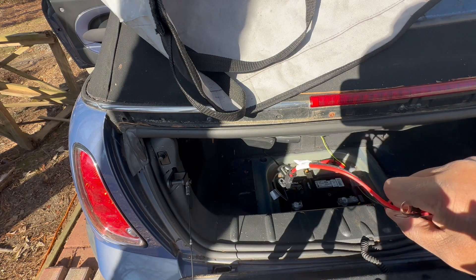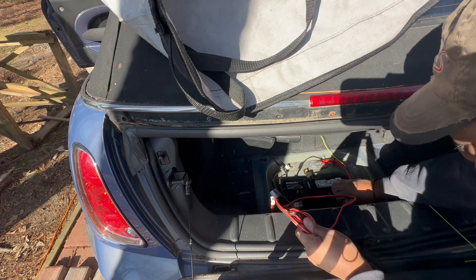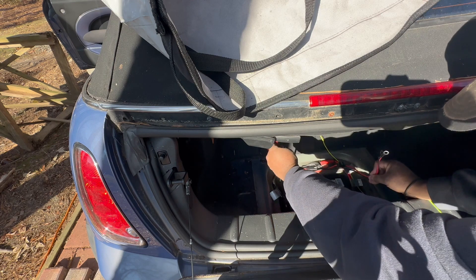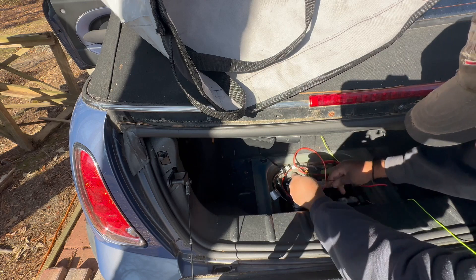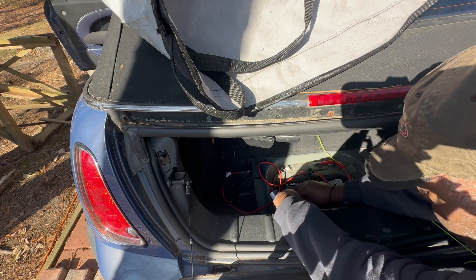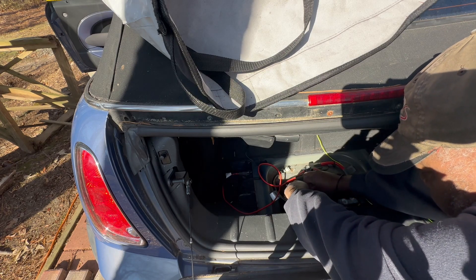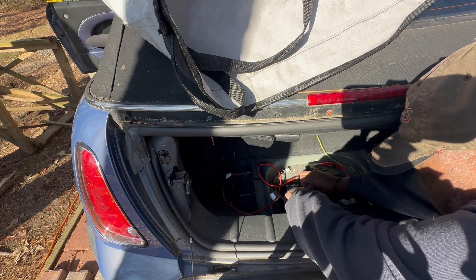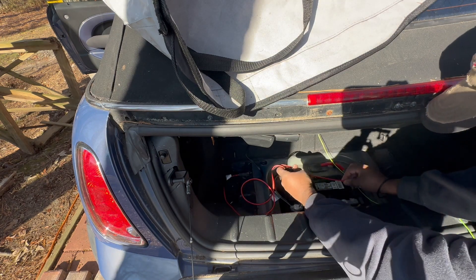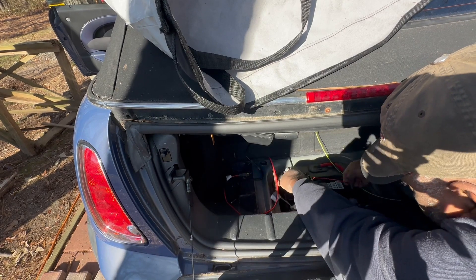I'll eliminate all the excess wiring under the seat. I'm putting the black negative on first. If you can't see it clearly, you know how to put an eyelet on a battery terminal. It looks red but that's just where the wire is split — it's actually black. Also note that the red wire has a fuse already in it. I'll route it underneath the battery holder so that if anything heavy is in the trunk it won't get smashed.